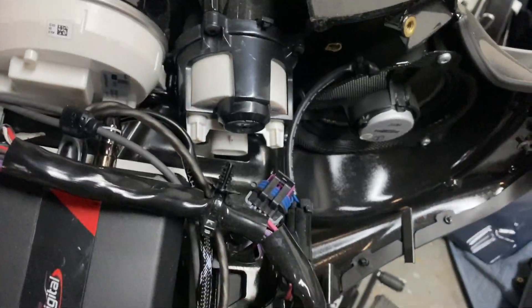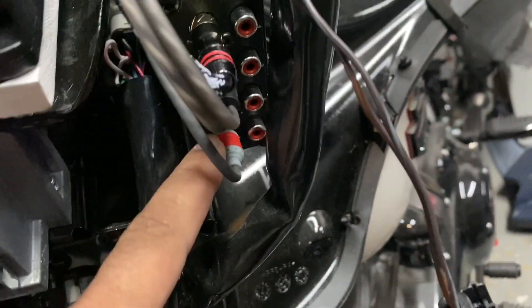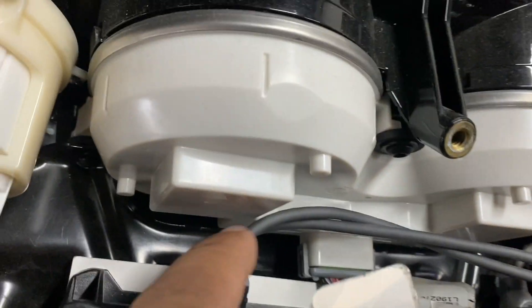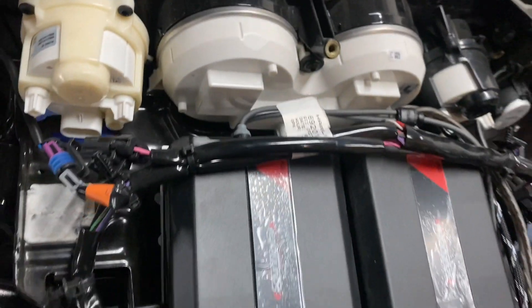We gave the 309 Customs the hardest job — from channel 8, the last channel on the DSP, all the way over to the last two channels on the 800.4. They reached beautifully. No kinks, beautifully — the furthest channel all the way over to the furthest channel, reached perfectly. And you can see the amplifier mount bolt is in, and we have plenty of space between the cluster and the RCA. There's no pressure on the RCA at all — it's not touching.